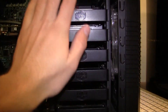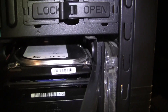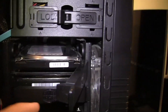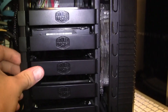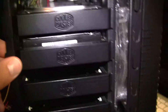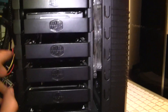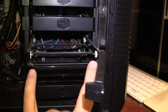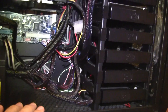Moving down here, these are all my hard drive bays. Only two of them are occupied. Right here is my OS drive, which is 500 gigabytes — I have OS X Lion and Windows installed on it, though I mostly just use OS X. This is my 1 terabyte drive, where all my backups, music, and videos go. So if my OS crashes, I don't lose anything. These other bays are just empty — you just pull one out, put plastic screws in the sides, pop it in, and plug in the SATA cable from the other side.